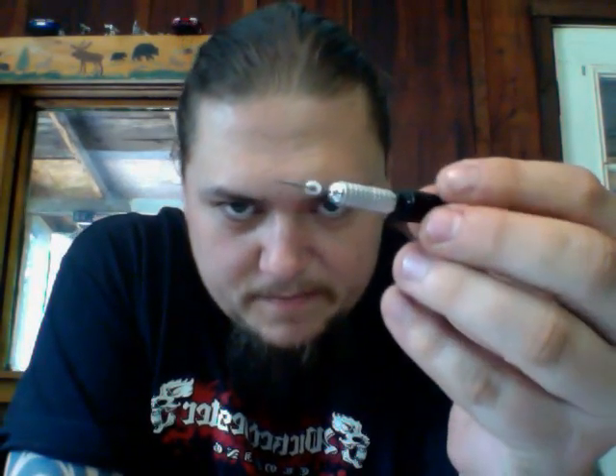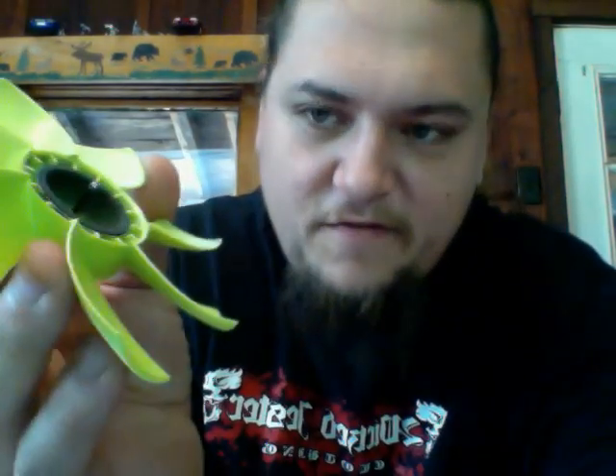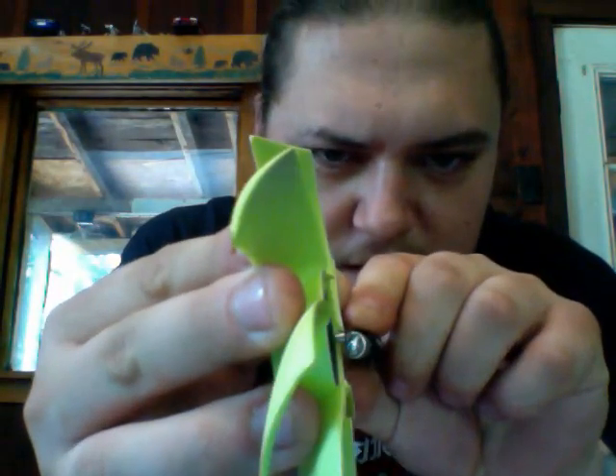On this little tiny, very flat ring, there is a gap. What you have to do is spread that gap apart and get it over the shaft of the fan to pop it out. All I did was put my knife in and started to spread it, putting a little bit of downward pressure on the fins of the fan to hold it and kind of lock it against itself. Then just work one edge out and run around it — it popped right out.